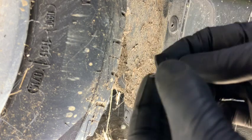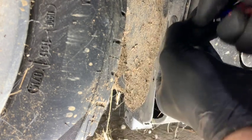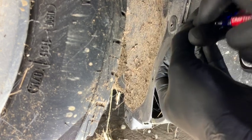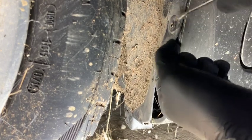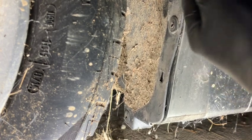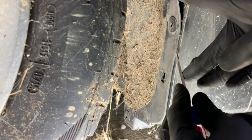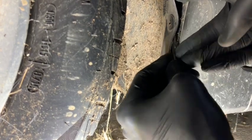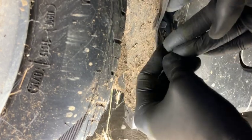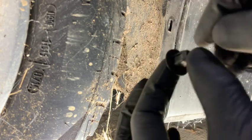These clips break a lot of times — sometimes you can save them, but often they just snap. Both tabs on this one busted out. I'll put a replacement link in the description below. It was always a bad design, and now that these clips are getting older they break really easily. This next one feels like it's going to be top and bottom, so we'll come from the top — and it just gave, so now hold out on the fender liner with your other hand.